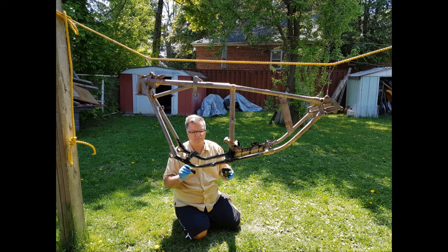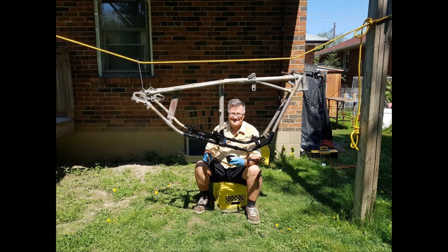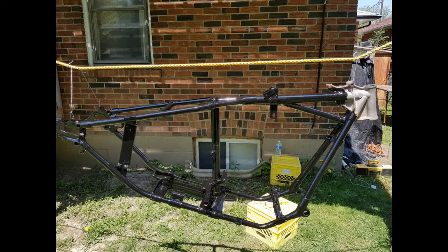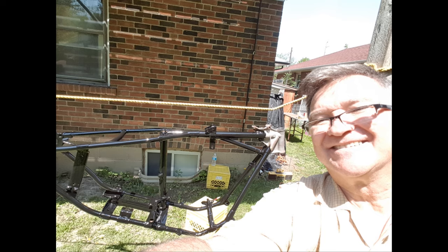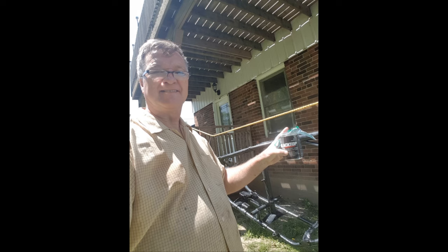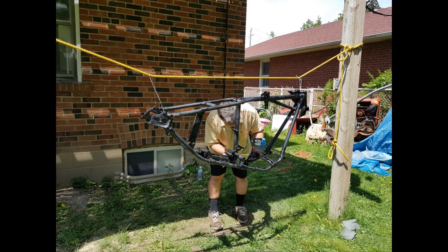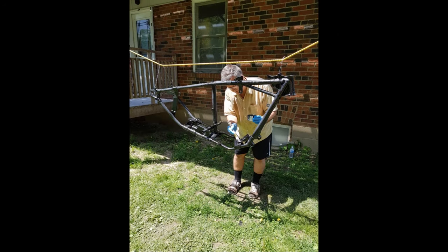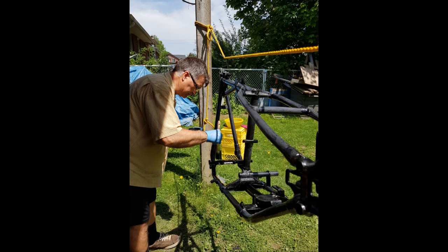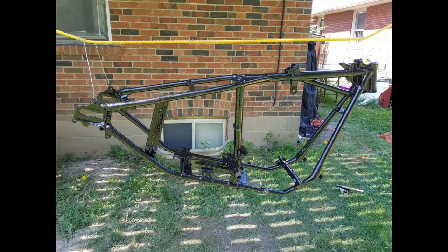Away I go. You're probably wondering what I'm painting it with — I did a lot of research and decided to paint it with KBS: the rust seal, then the black top. I don't recommend this product though — you've got to have the perfect environment. It's a good product but you need near-laboratory conditions. If it's too hot or too humid, it dries too quickly on the outside and the solvent on the inside bubbles out. What should have taken a couple hours took me two to three days, but it did come out perfect when I was finished.